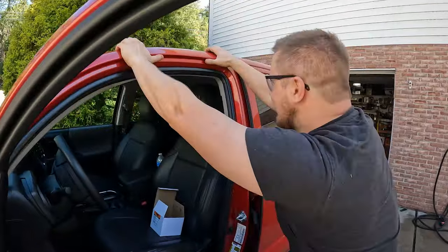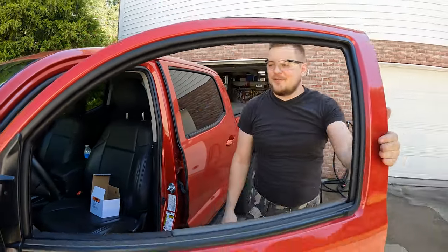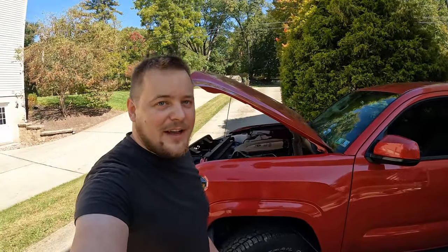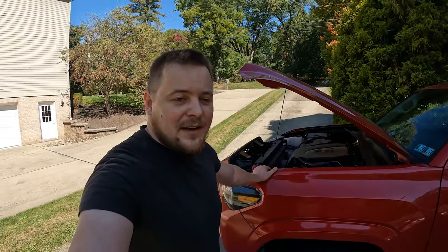Now I've got some noises in the back, but no more annoying sounds in the front — which is a win. This front mount I bought on Amazon, I'll leave a link in the description. Let me know if you had the same problem — I'm curious if there's something else that could have been done. That was a rather easy fix; all I needed was to jack up the cab a bit and get that replaced. So if you have that horrendous screeching noise in your front end, make sure to take a look at that front body mount.